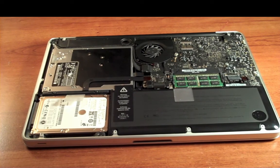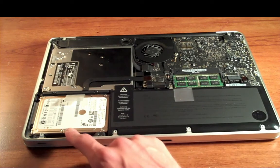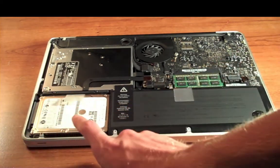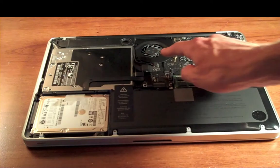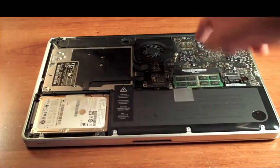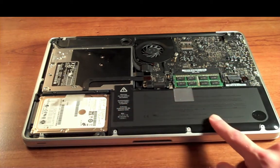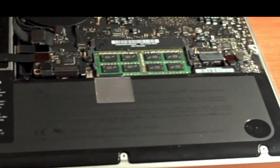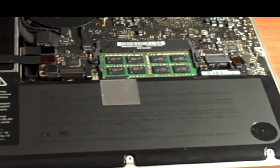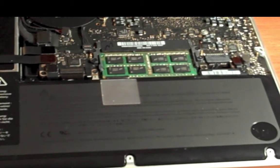Let's do a real quick tour around the inside — it's pretty simple. Here's your hard drive; this happens to be a 250 gig, 5400 RPM — Apple's MacBook Pro ships with Fujitsu drives. I'm going to upgrade that to a 500 gig 7200 RPM drive in the near future. Up here is your SuperDrive, your fan, and the processor is right under this. Here's your memory, and this is your battery — it says warning, don't take that out. This laptop uses DDR3 PC3-8500, that's 1066 MHz RAM — pretty much the latest for mobile computers.